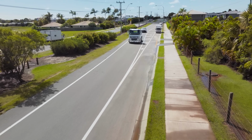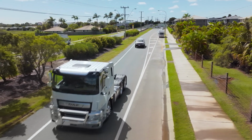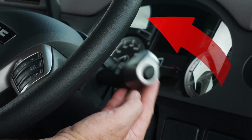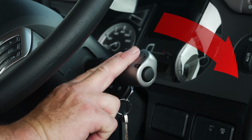Manual gear shifting in the Traxon gearbox is only possible with the eco mode function switched off or in manual mode. Manual upshifts are achieved by lifting the right-hand column switch up. Manual downshifts are achieved by pushing the right-hand steering column switch down.